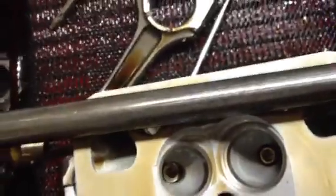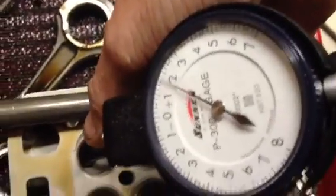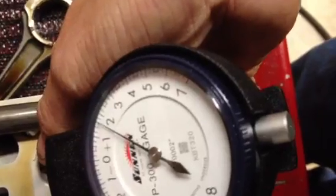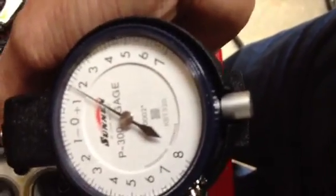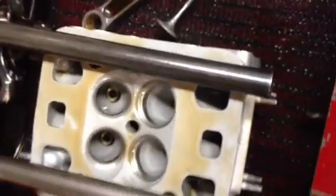This guide has already been sized — I've already achieved my number on this. Basically what you do is take this probe, slide it down into the guide, and it will tell you the clearance. If you recall, when we set it on the blocks over there it was set at zero. As I move it up and down in here, we have a thou and six tenths of clearance because it's oversized. I'll make sure I'm holding it centered, and as I move it up and down you can see I'm within a tenth of my measurement. That's basically the right way to measure valve guide clearance.